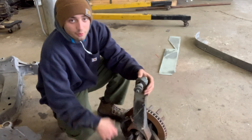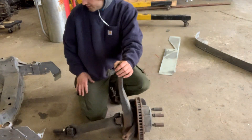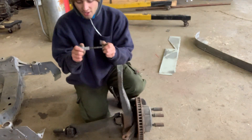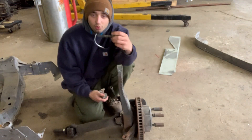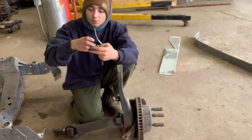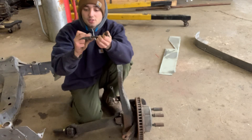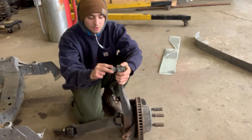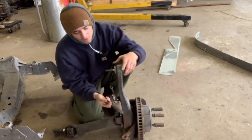So this is how our rear wheel sits in the frame. There's no control arms in the back — this is called a trailing arm. It's got a pretty cool thing on here. Originally the trailing arm sits in the frame in the back with just a bolt and shims on either side to keep it aligned. This is a cool little racing setup — just two little joints with the bolt running through here. It's still going to have to be shimmed, but it will center a little bit better. Oh, maybe that is all stock actually. Yeah, that is stock equipment.